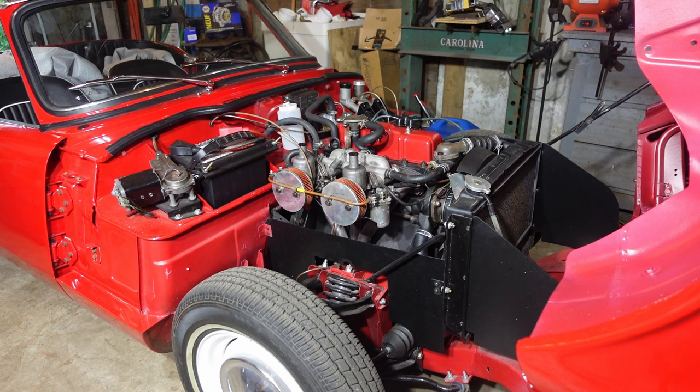I had her out and she got further, that's for sure. But once I get up to 3,500 to 4,000 RPM that's all she'll take — any trying to get higher than that and it starts to bog down and eventually just clunks a little bit. She pulls okay up to there, but when you get to that point there's just nothing left. Maybe a fuel delivery problem still at high RPM — I'm not quite sure how to test that beyond what I've already done. The car show is Sunday — I'll go regardless unless it's pouring rain. I appreciate all the help, words of advice — keep them coming. I'd ask that you go back and watch the other video to get the full breadth of what I've looked at. Appreciate it, have a good rest of your night, cheers.